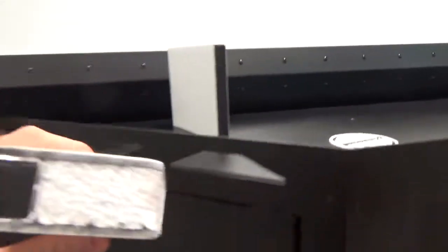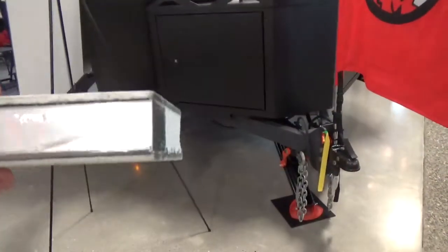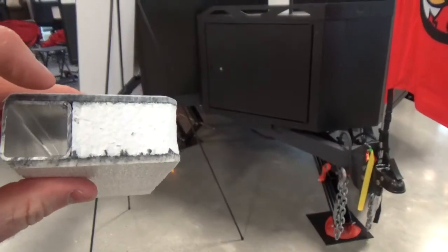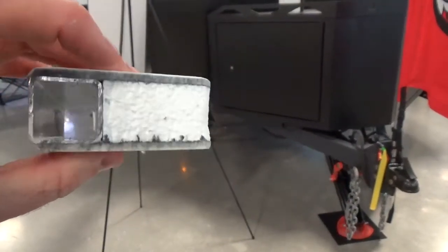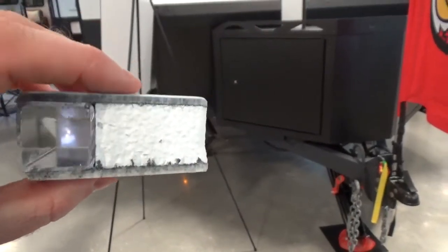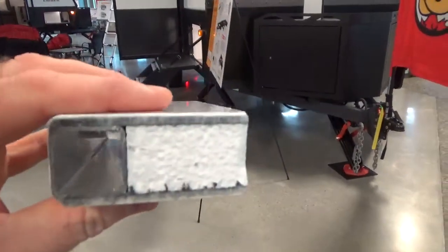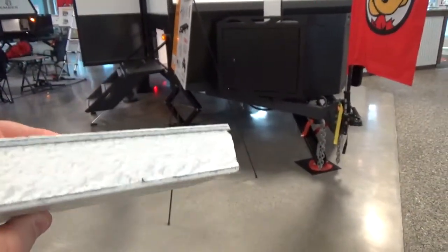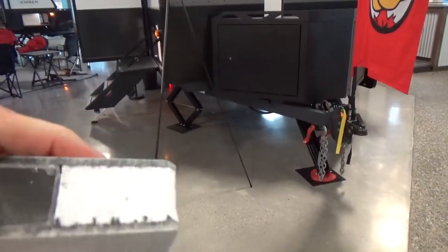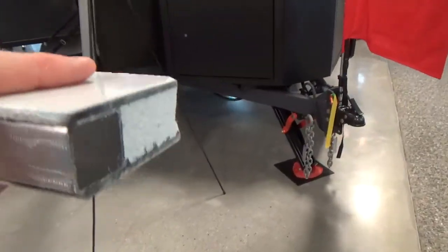The other thing is they use a laminated fiberglass sidewall with block foam insulation, aluminum tubing in the sidewall. But the difference is that in most products in the industry, the fiberglass panel is bonded to a wood backer, plywood, also known as Luan. It's almost like a sponge. So if you have an inferior seal on your trailer, or you just neglect to maintain the sealant on your trailer, moisture can get in, and that Luan soaks it up, and then you get delamination over time and rotting and all the disadvantages to that.